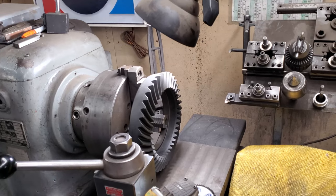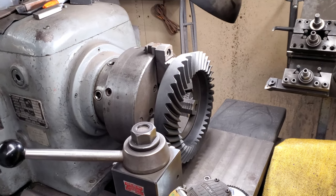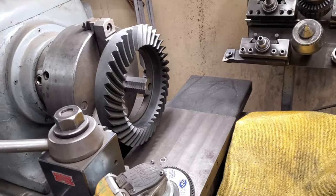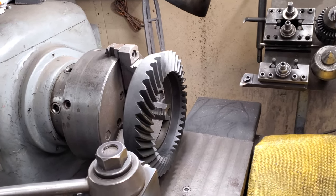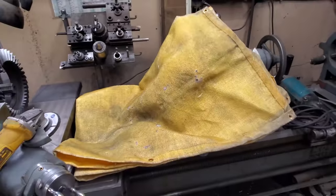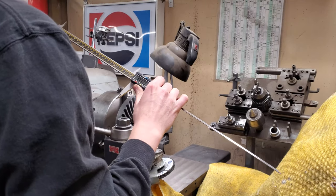What I'm doing now is shaving down the ring gear a little bit. The instructions from Ballistic for their shave kit say to take about an eighth inch off the radius of the ten and a quarter ring gear, bringing it down to about 10 inches diameter. From what I've read, a grinder is the easiest way since the ring gear is so hard — can't really cut it very well with a normal cutter on the lathe. I put down a welding blanket so I don't get grinding dust all over the lathe.